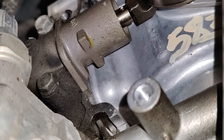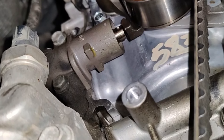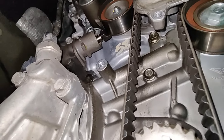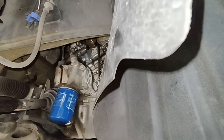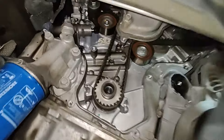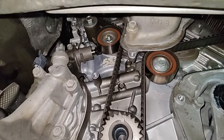You can already see that tensioner is leaking — make sure you change it because it always leaks. Honda's fixed pricing does not include the tensioner, so make sure you get one of those. It's nice that they now bolt it on the outside of the timing cover instead of inside like they used to, where you'd have to take the entire timing cover off to change it.